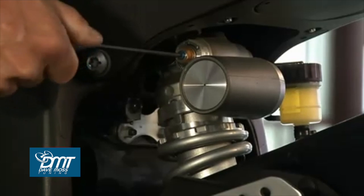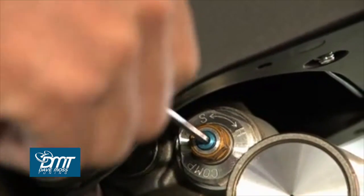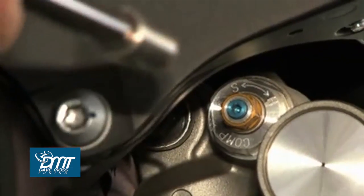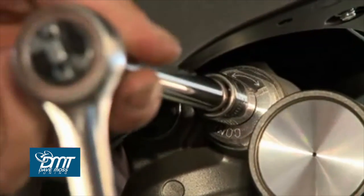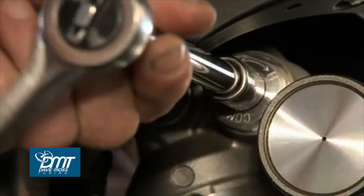Now onto the rear shock. There are several things to look at. We're going to start with compression. It is exactly the same tools as we just did on the front forks for high and low speed compression. 3mm Allen, the low speed compression clicks again, and then a 12mm, and the high speed compression is just purely turns. In each instance we are going to the right until it naturally stops, record what that was, and then put it right back in the set.